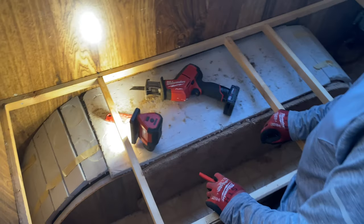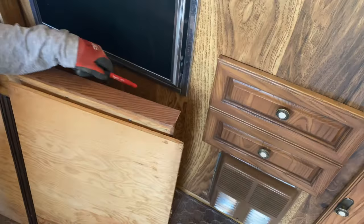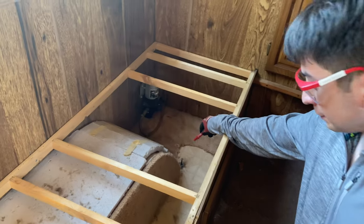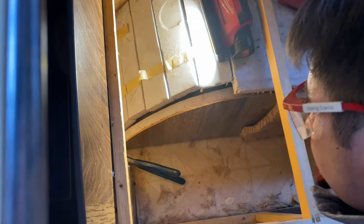All right, so recap: there's a bolt and a screw holding it into the frame in that corner. There's a bolt and screw in that corner. In front of the wheel well in here, you can access it through this. There's another screw you have to remove there. There's a screw right here. And then there's another one right under there, but it's really tricky to get to. I removed some of the carpet. It's underneath here, basically where that dot is. All right, so look at it.